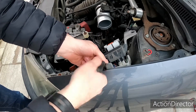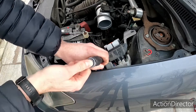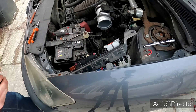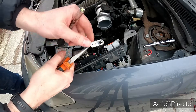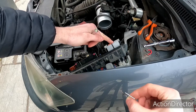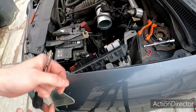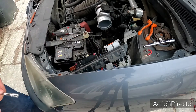I'm going to undo this bolt in here - it's an 8 millimetre bolt head, quite tight actually. The screwdriver gives you the attachment for the wrench to go in there as well. There we go - crack that and just go about unscrewing that, careful not to drop it. Then you should be able to just pull out that tab. The plug itself - I'll show you later before I reinstall it - basically looks similar to one of these but with two legs that stick down, one either side. Just with it being the 100 amp main fuse, that's why it's bolted rather than just a push-in fit. That's one side out - I'll put this bolt back in so I don't lose it.